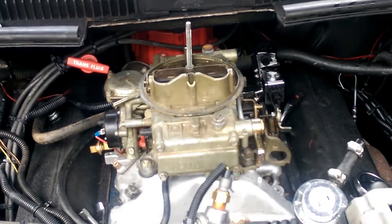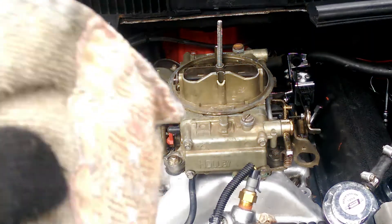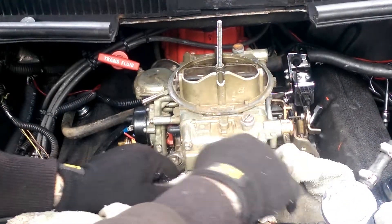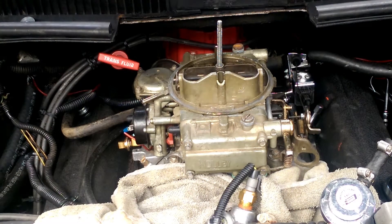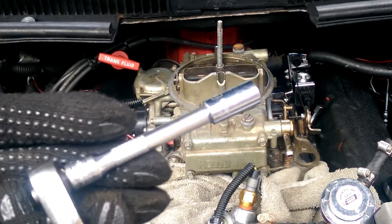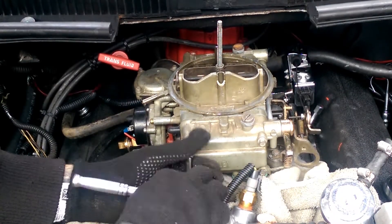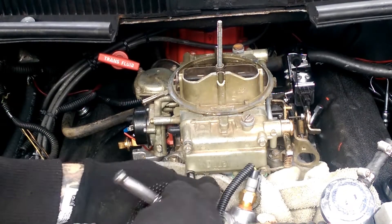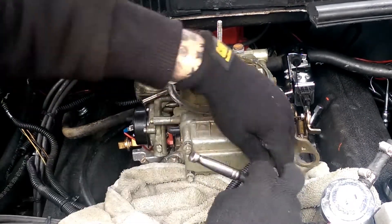There we go. Got some gas leaking out — that is normal. Gas coming out is normal. We're going to get a rag under there to catch the gas. We went and got an old towel — it'll do just fine. Stick it under here because there is going to be fuel — no doubt about it. You will have fuel leaking out, you're not going to get around it. Take your ratchet wrench — I'm using a ratchet and the socket is an 8 — and they're not super tight at all, you can pretty much just turn them easily.